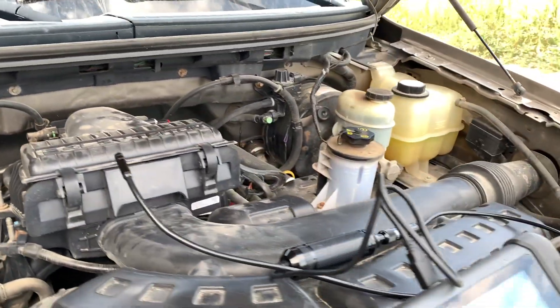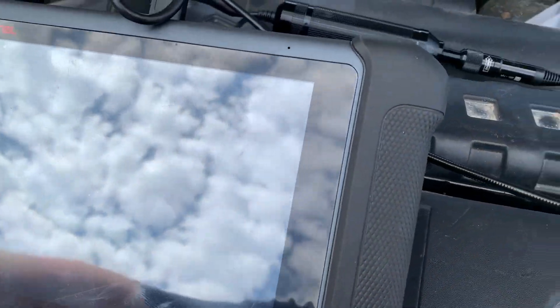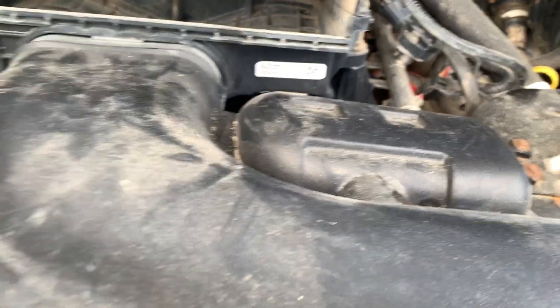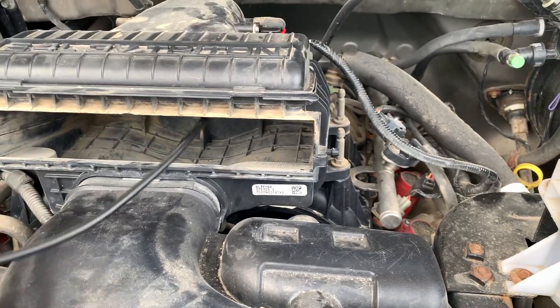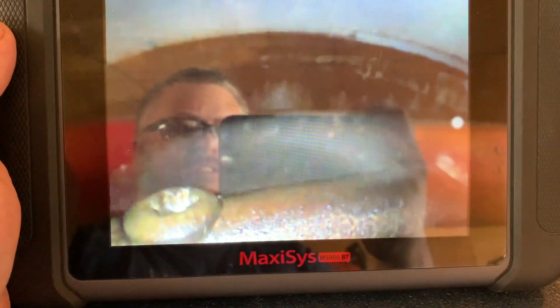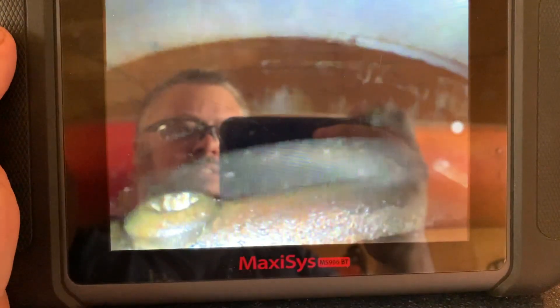So I've got my 5.4 liter engine here. Accessing the throttle body isn't all that easy to verify visually, so I've got my scanner here with an inspection scope so we can physically go right inside. I ran the bore scope inside and the video clip is the best way to tell if the throttle body is working smoothly. Opening and closing it slowly, it seems to be moving okay — it's not binding, not sticking, not jerky. It is extremely dirty though; I need to clean that up.